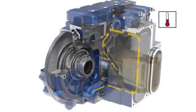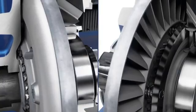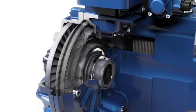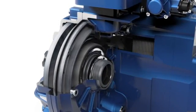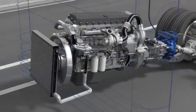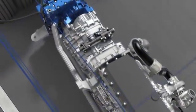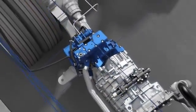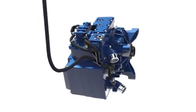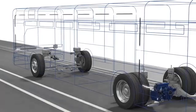After each braking operation, a spring moves the rotor back into idling position via a helical gear. This rotor shift away from the stator prevents ventilation and consequently unnecessary fuel consumption. During braking, the engine does not burn any fuel, meaning there is no additional combustion heat, and the cooling capacity of the engine is exclusively available for the retarder. Temperature sensors at the electronic control unit (ECU) monitor the system and therefore exclude the risk of overheating.